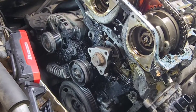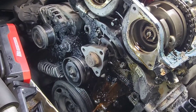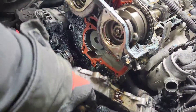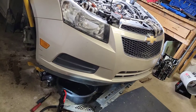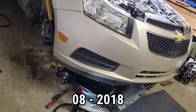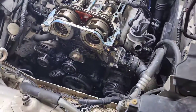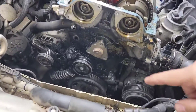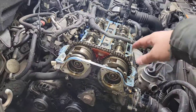Coolant's gonna start coming out gushing here when I pull this water pump out — just like that. All right, here we go. Chevy Cruze 1.4, same thing as 2008 up to 2018 or something like that. Gonna show you how to drain this coolant out. You can see what I've been working in here — changing the water pump. Big mess right there; whoever did this job before...